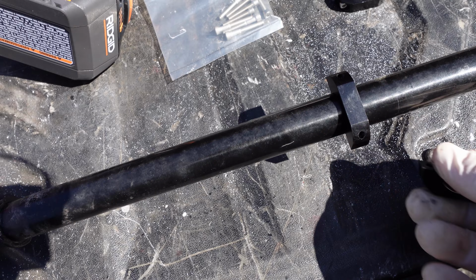So I bought lateral locks from 1320 Performance, that bolt on. And you'll see what I'm talking about right here on the other side, how it completely fell out and the bushing is separated from the mount. The lock is somewhere underneath here on this side. And I think it's just, like I said, welded in the wrong area. What I'm going to do is grind it off and put the bolt-on locks on the inside. And I'll show you what I do.